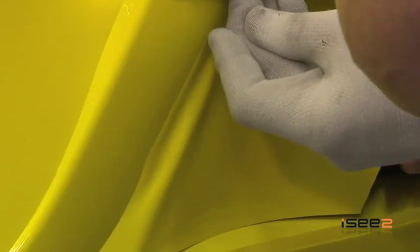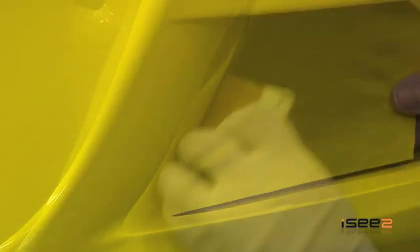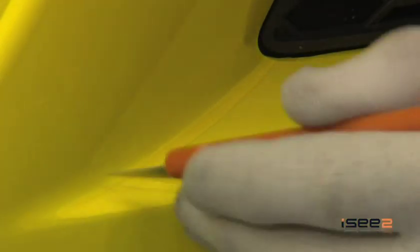As you apply the film to the rest of the panel, use your heat gun to re-tension it and use your squeegee to remove any wrinkles. If you're cutting vinyl directly onto vinyl, you won't need the trim tape. This is to be used only to avoid cutting directly onto paintwork.